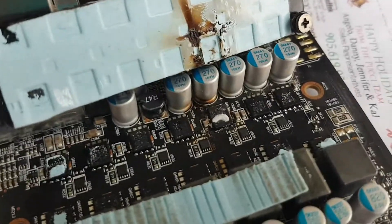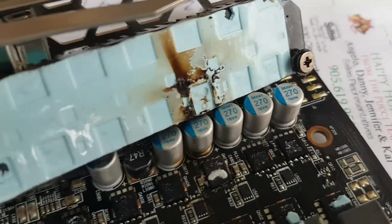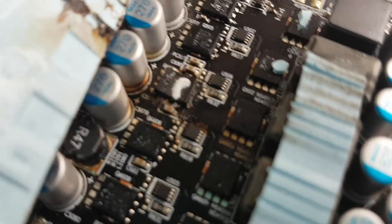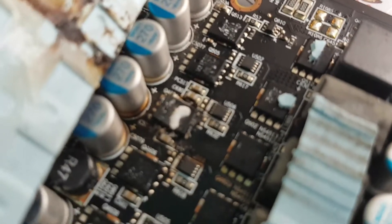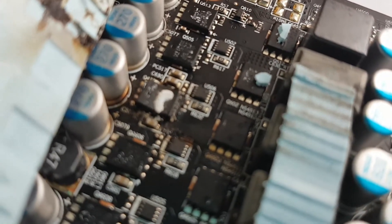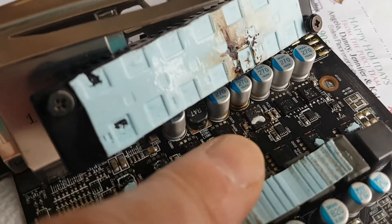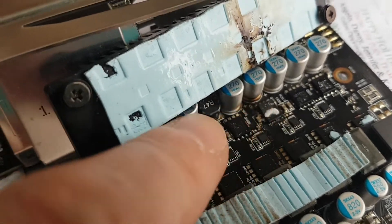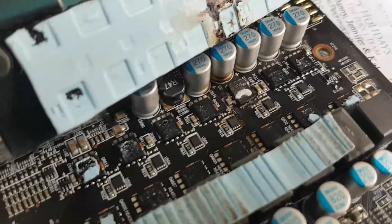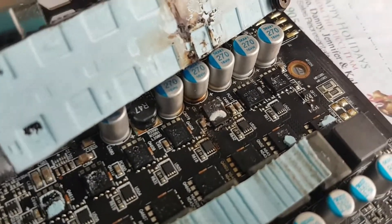It's right around the back of the capacitors — exactly where the guy told me he hit his ring. You can see the explosion mark on the thermal pads, and it's a little hard to see but there's clearly been an explosion on the motherboard. That chip right there has a white mark on it — that's just the thermal pad being glued to the chip, and it's exploded through the card. I don't know if this card is fixable, but I'm going to try to remove that component, clean up the area, and see if we can get the short removed. Then maybe I'll give it a power-up — it's already blown, it can't get much worse.